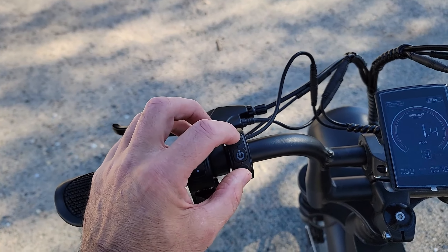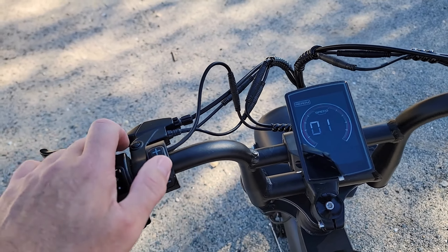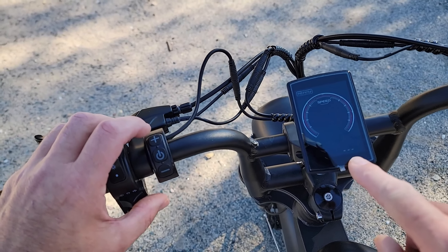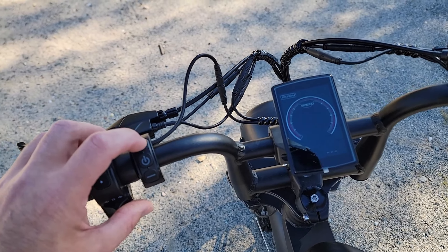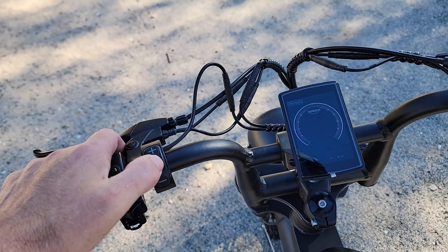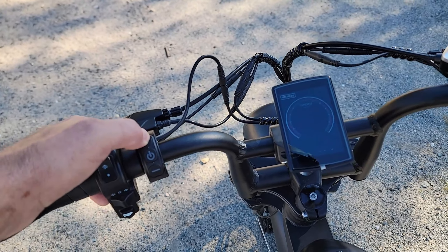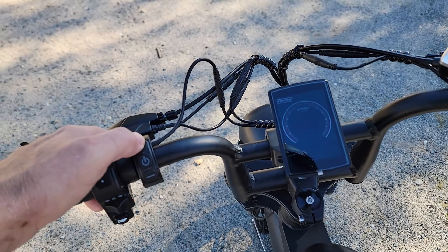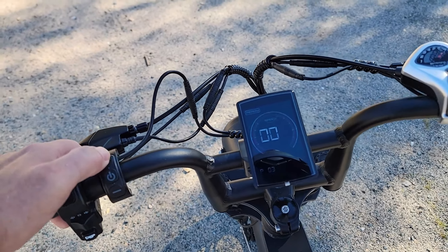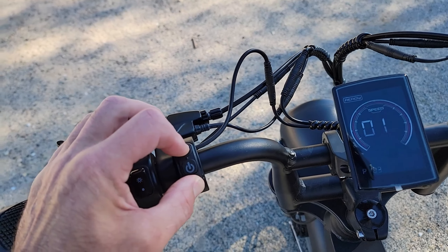In order to change that, you have to get into the menu — press the plus and minus button together. Then to change the PO number, you press the power button. You get the three, and you've got to change this to all ones by using the plus or minus button. It's just easier to use the plus. To move to the next one, two short clicks of the power button. Two short clicks, go up to one. Then change this from double zeros with the plus button to one. Press the plus and minus button to get out of the menu.